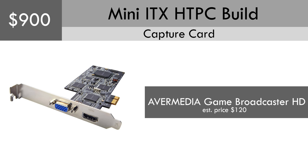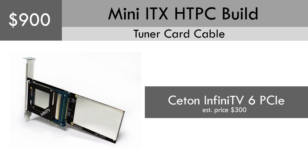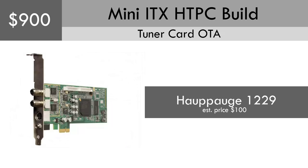With this build, I have tried the AMD R7-250 low-profile graphics card in dual graphics, and this was a very cool setup. Though I couldn't play modern games on high settings at 1080p, dual graphics looks very promising in the future, especially for low-profile HTPC builds, because I got something like a 30 to 40% increase in my graphics power. Also, you could install a cable card tuner like the SiliconDust HDHomeRun Prime, or an over-the-air tuner, and give this PC some DVR functionality. Basically, the choice is yours.